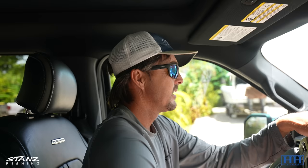We're back in the truck — it's an F-150. The X3 is not a huge boat but it's a decent-sized bay boat. Our trailer's at the house, so we're going to pull into our neighbor's yard. Luckily they don't complain. If you know your neighbors, it's always a good thing. One tip I'd give you guys: we have lithium grease from Blaster, and that makes the ball come on and off the hitch a hundred times easier. The other day we could hardly get the hitch out of the truck, but a little bit of grease made it come in and out so much easier.